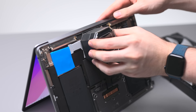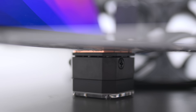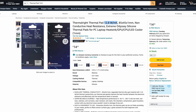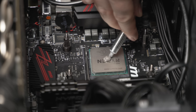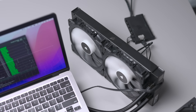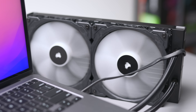Here is how I ended up testing what effects the liquid cooler would have. I kept those thermal pads from the thermal mod attached and simply placed the MacBook Air on top of the AIO block, making solid contact with the gray thermal pad. This pad is directly on top of the M1 chip, as this is where all the heat is coming from. This thermal pad also has a very high thermal conductivity rating, so it should transfer heat into the AIO block quite effectively — it's not as conductive as thermal paste, but using thermal paste here isn't really possible or practical. The weight of the MacBook kept it firmly attached to the liquid cooler block without needing any props or weights. There are some limitations — for example, the orientation of the liquid cooler block and radiator, and the AIO fan and pump speed cannot be controlled, so it's at a default low setting. But as you're about to see, none of this really makes any kind of difference.